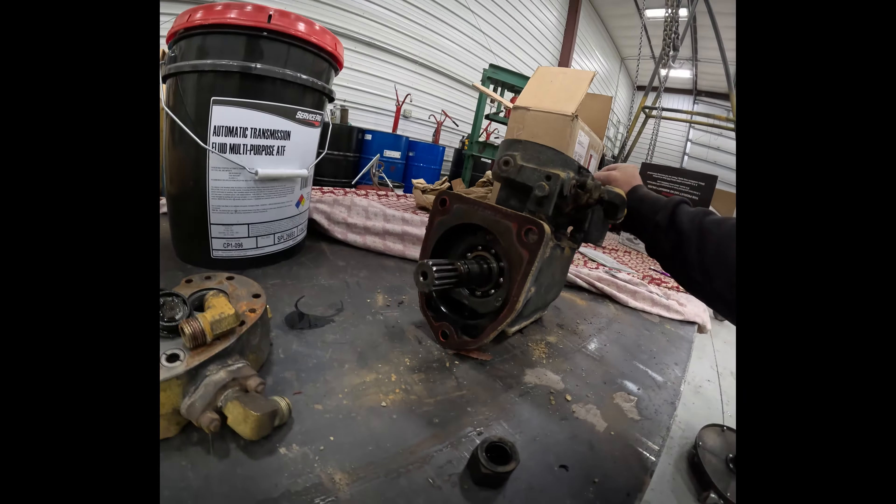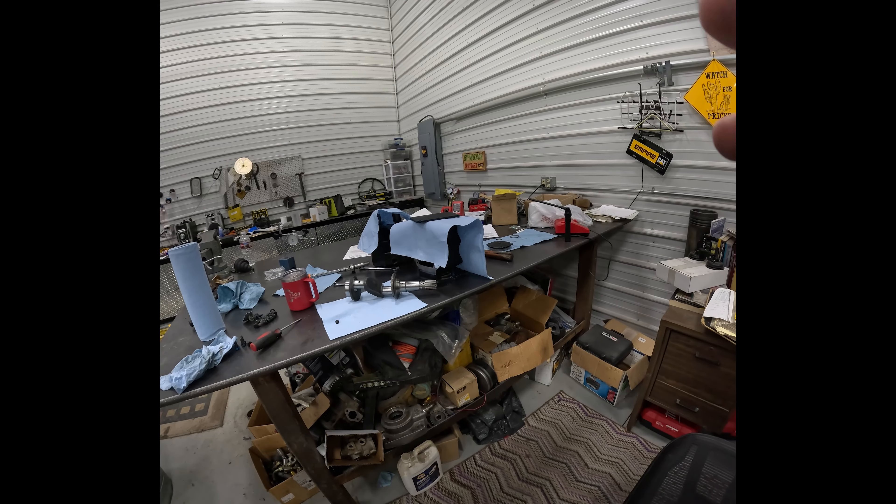That's just not threaded — that's a big oil hole, so I'm going to leave that plug out. I think if you left the plug in you could destroy the compressor. I don't know if the ball bearing is a better design or that bushing is — I kind of like the ball bearing because of the size of it. I've done about all the damage I can do here until I get those gaskets, and then I can put it back together.